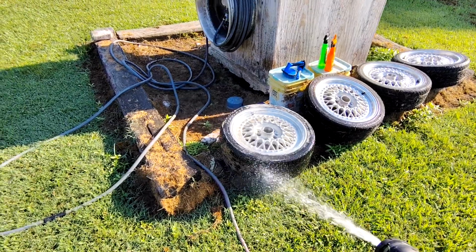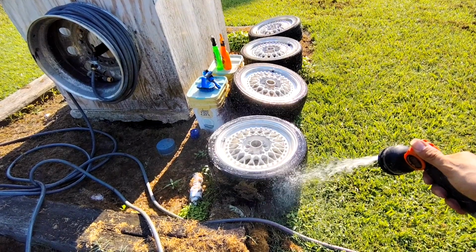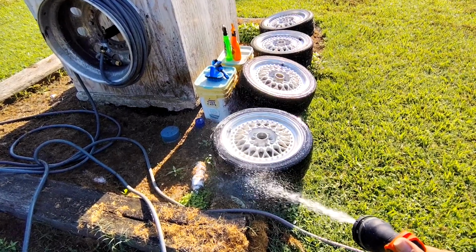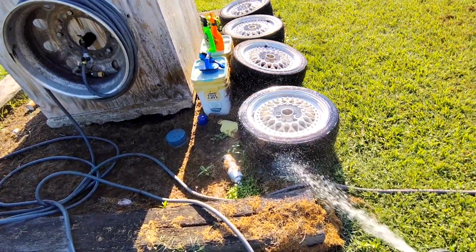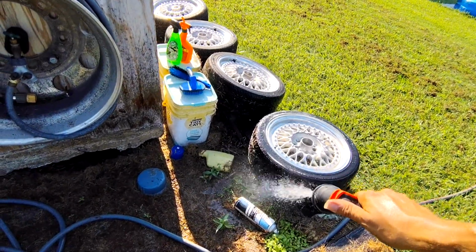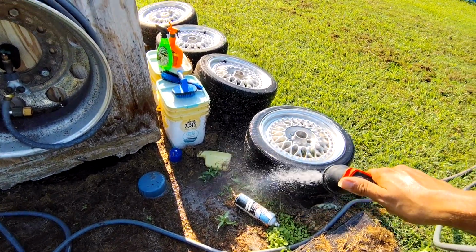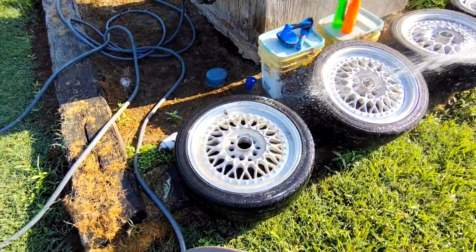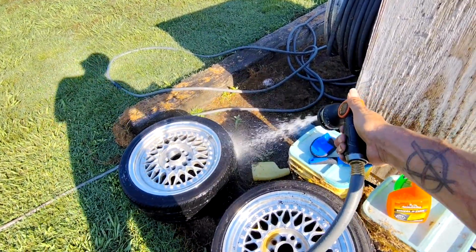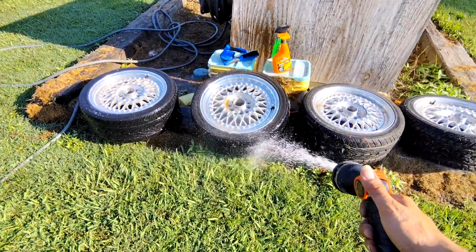And then they're going to go back on the car, probably go ahead and put them on today, just because other than going and buying a can of fluid film and just literally soaking the inner fender wells and getting all that stuff under there super juicy as the start of some kind of an undercoating to kind of just stop what rust is around. I've found more and more as I look around and under the car, and none of it's super bad in places that are terribly critical, but the fact of the matter is it's there. And I don't have the means to do the body work to get rid of it correctly, so I'm just going to treat it with some goopy stuff, which has been known and even sold as an undercoating item.